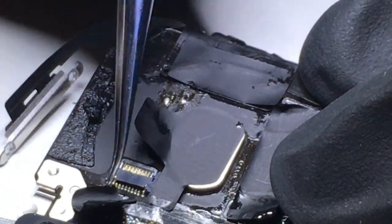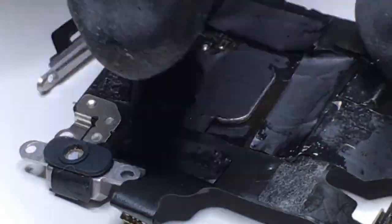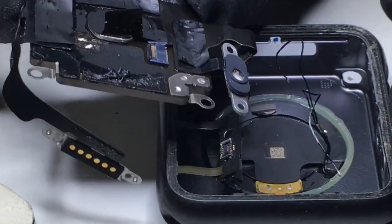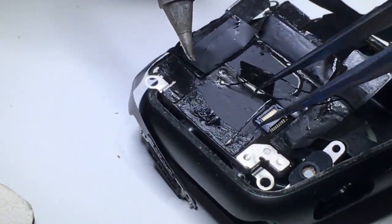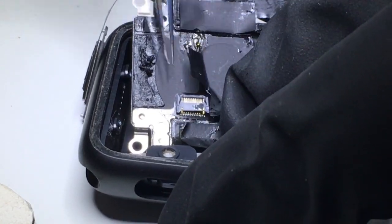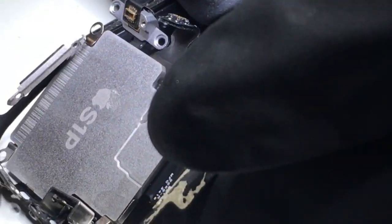I'll clean that up and put the sticker back on, then this one as well. Next, I'll show you how to reassemble it. Once you've done what you need to do in there, you'll grab the cable with the white paint on it and stick that on the right side like I mentioned earlier. Then you'll guide these under the sticker and around the little metal sheet in the middle — and this is where I realized how stuck that other flex cable was, held down by the epoxy. Carefully lift it up.